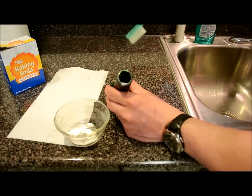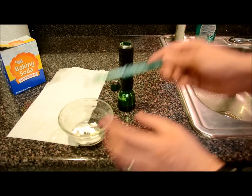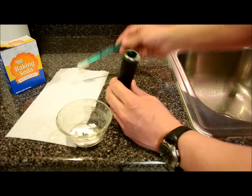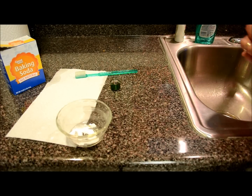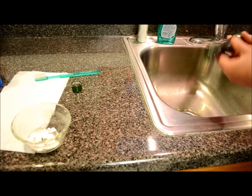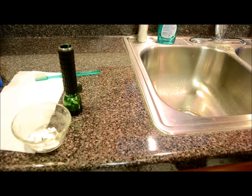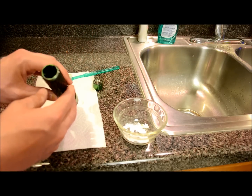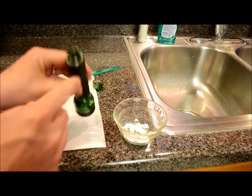This is looking pretty good. I can see way down at the bottom — I'm getting a little bit of goop on there which is okay because I want that goop all the way down there. Last thing I'm going to do on this one, and it's safe to do with most toys, I'm just going to rinse it out with water. Getting a little water in there actually helps get the rest of the baking soda over the entire surface. And now we're going to simply let this dry for probably a day or at least overnight. Let it air dry, and that should get rid of all the corrosion. Tomorrow, or next time you see me, it'll be in the morning and I'll put the batteries in and we'll have a light.